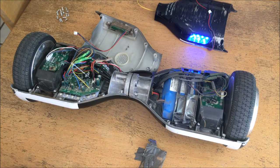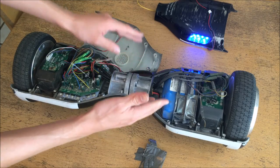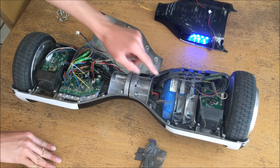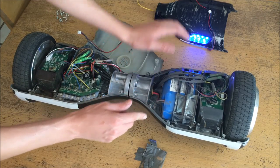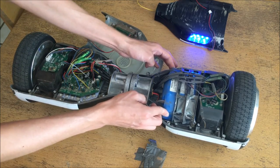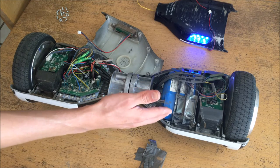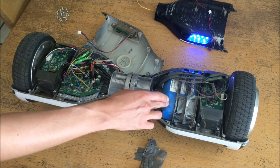I'm going to inspect the wire connections and the battery compartment. When I was disconnecting the light I noted a fairly serious issue: the battery holder has completely sheared off of the actual chassis of the vehicle, resulting in the battery perpetually hanging down and compressing the wires against the underside of the plastic cover. This is a problem because if the battery rattles around as it has been doing, it can wear down until a failure occurs. I'll need to either perform a short-term temporary fix or find a way to properly remount the battery bracket to prevent future problems.